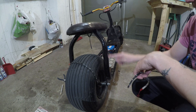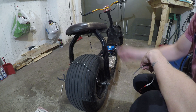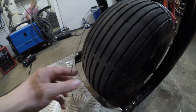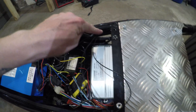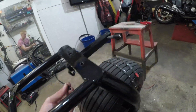I'm gonna route the cables on the inside of the tube. I already made the holes before — one up here and one down close to the electronic box. First thing to do is to remove the seat, and then I fed a piece of steel wire — actually a three-strand that I twisted with a coil with a drill. I poked it in here all the way through until it comes out, and then I feed my cables through. Next thing I'm just gonna start soldering these connections up.